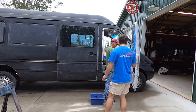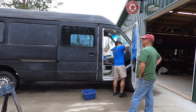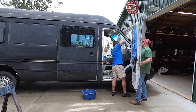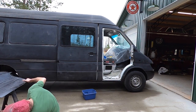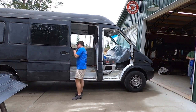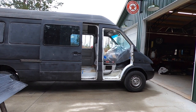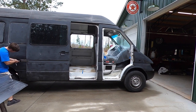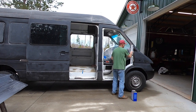Once we got it masked off we continued taking the doors off, took out the bolts, and it took a while to get all that apart. But in the end it was really worth it because the doors came out with a really good paint finish, and it allowed us to get into the door jambs really well. If we had left the doors on with all the hardware and rubber boots where the wiring harness goes, we really wouldn't have been able to spray completely in those spots — there would have been white showing in some places when you opened the doors.